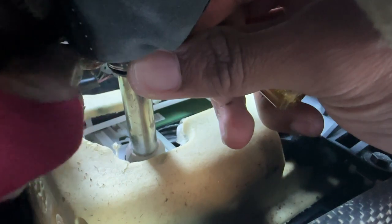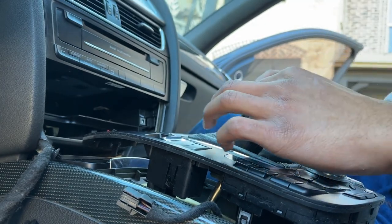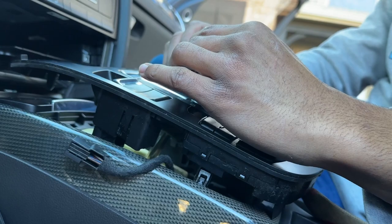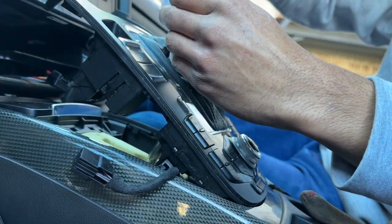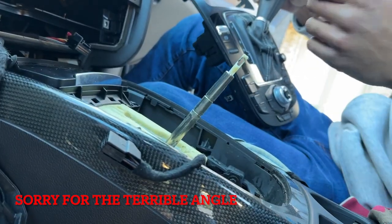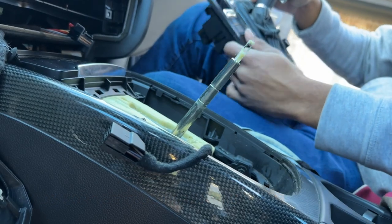The rest of this should come out pretty easily. Just bend it out just like that so it comes all the way off. Last thing you need to do is get the gear shift lever off — all I want to do is take the silver part, pull it out right here, and simply just pull up and it comes off just like that. What you don't want to do is don't let this slide back in or you can't put the gear shifter back on. So take your silver hose clamp, slide it under the silver lever so it won't slide back in, and it should hold just like that.